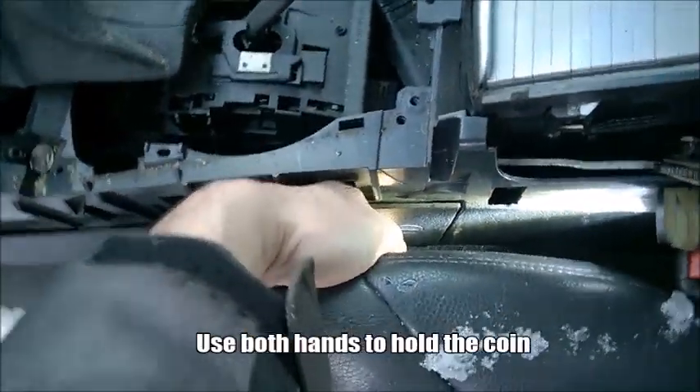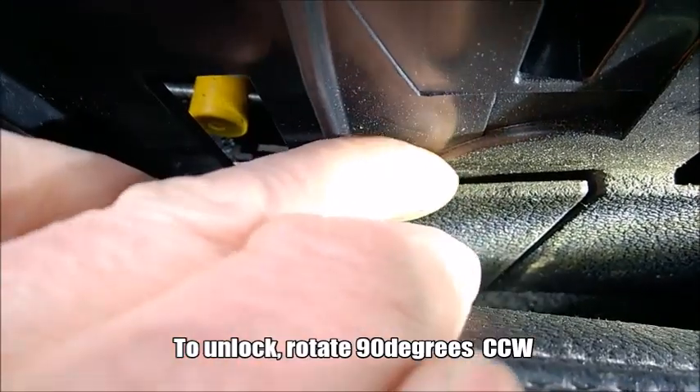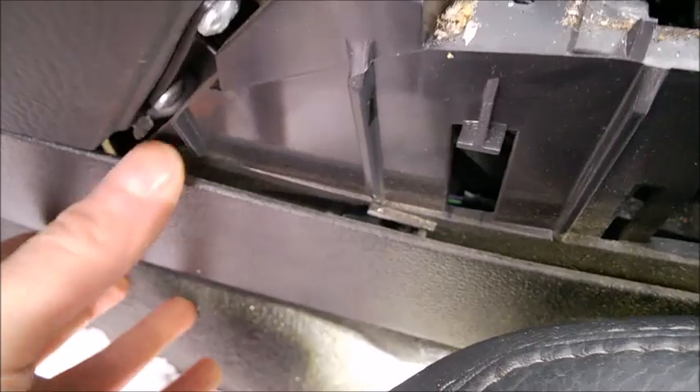You perhaps going to drop it somewhere. It's horizontal when it's locked — rotate it counterclockwise, just like that, and then pull a little bit — that's unclipped. Then the next move is to pull it towards the rear of the car, just like that. A small pull and this will disengage it.